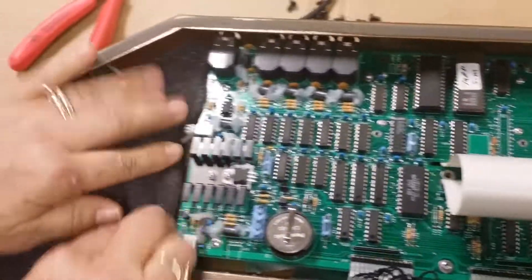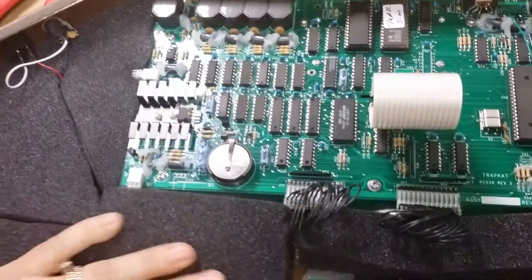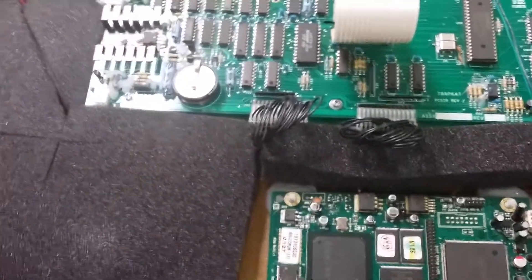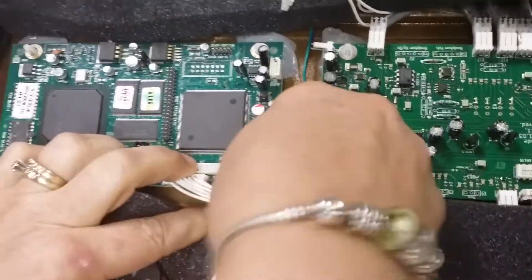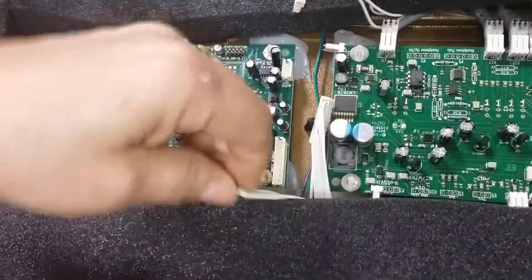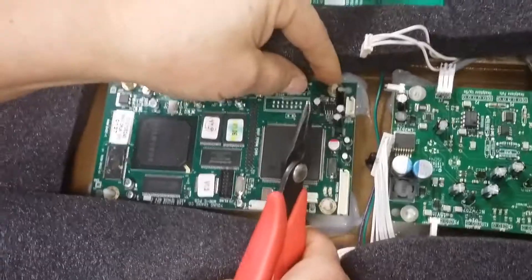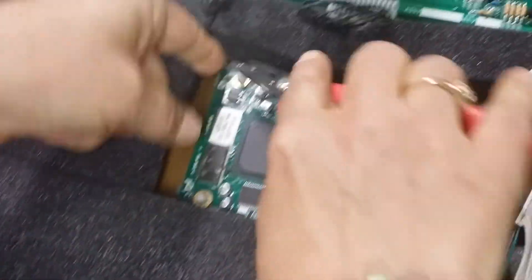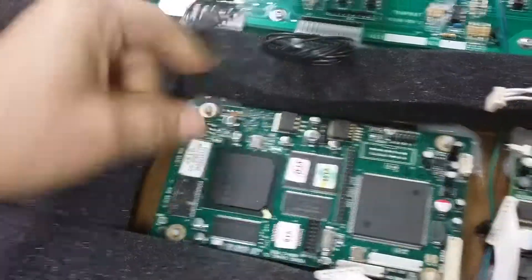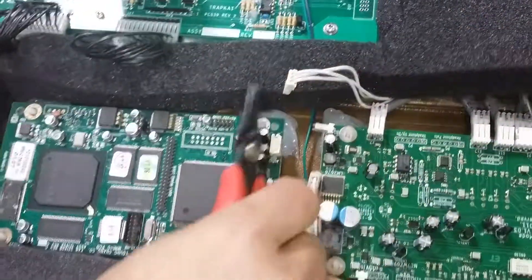Now tuck that under and you can put your foam back or just leave it out. Your third thing is to eliminate your boards — start unplugging your cables. The way you do it is you pinch the plastic little standoffs, pull up all the way around. There are four of them. You can do this with an exacto knife or your nail — just pinch them and it lifts up.